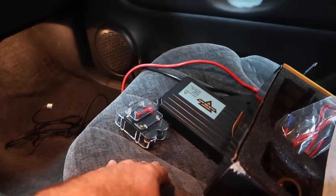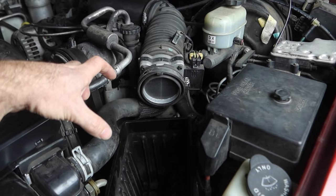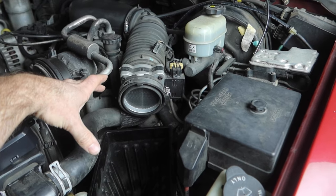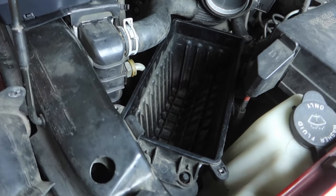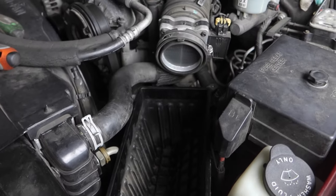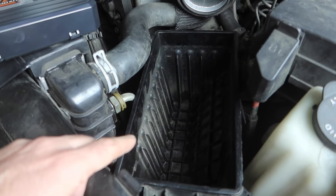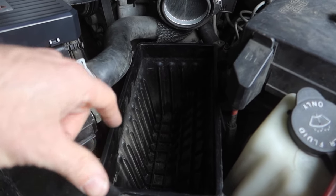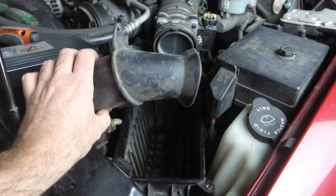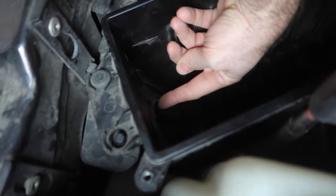I have a pretty cool solution under the hood. Under the hood we have where our intake was right here — our intake box, where our air filter was. I'm going to run basically a generic three-inch cone filter that's going to go on this tube right here. I'm going to utilize this intake box and mount the control module inside of here. I'm also going to mount all of the winch controller stuff for the new Harbor Freight winch inside this box as well. I've already taken out this little knobby tube right here, so I have a nice hole that my battery wires and everything can go through.